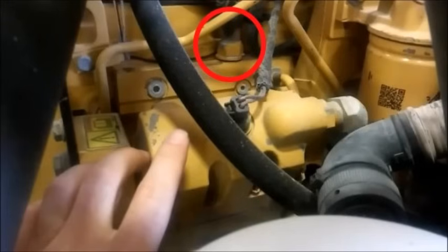If you don't see any leaks, look for the HEUI pressure sensor circled in red. You can remove that and put a pressure gauge in that rail — it doesn't have to be where the sensor was, just in the rail next to where the sensor is. When you crank the engine, you can test the pressure. Be careful though — that pressure can get up to several thousand psi, so make sure you're using a high-pressure gauge.